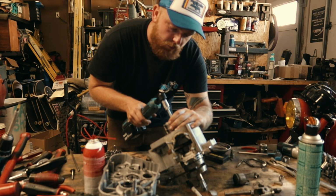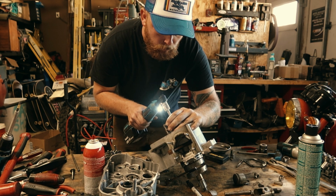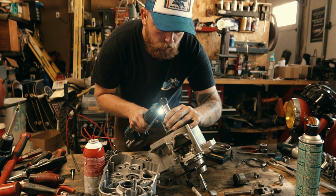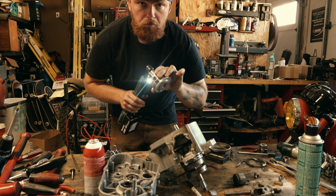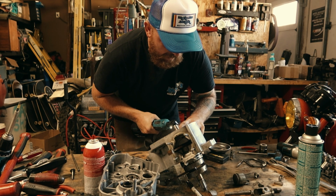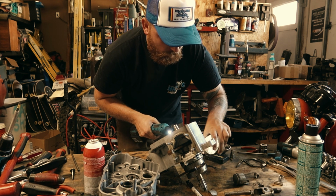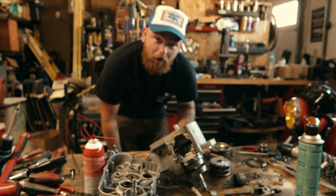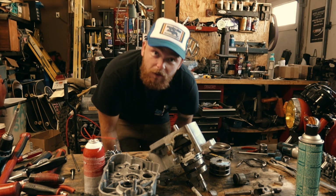But yeah, let's try doing that. I've never actually done it this way. Works. So, yeah, if the magnet's stuck for your alternator or generator or anything on these things, I guess that bolt trick works. Just find a random bolt laying around, thread it in, and it backs up against the crankcase.